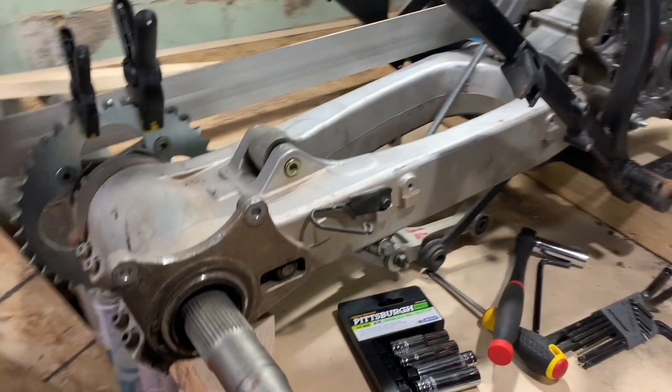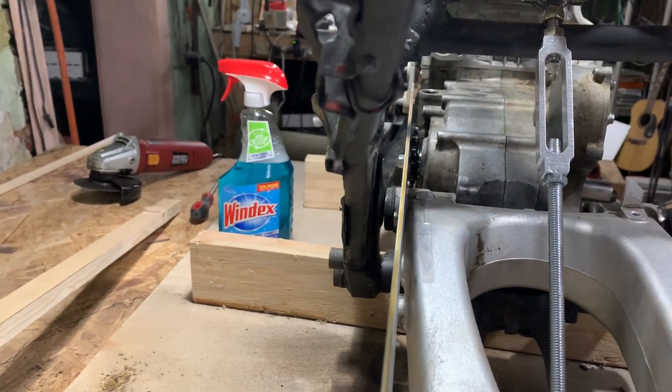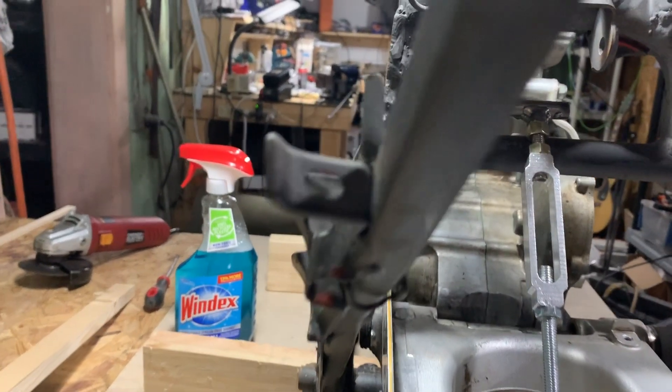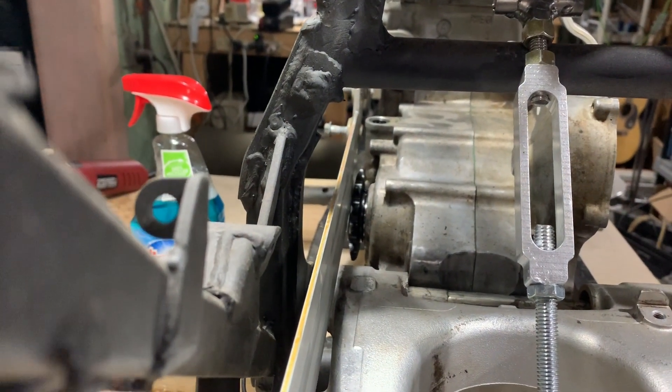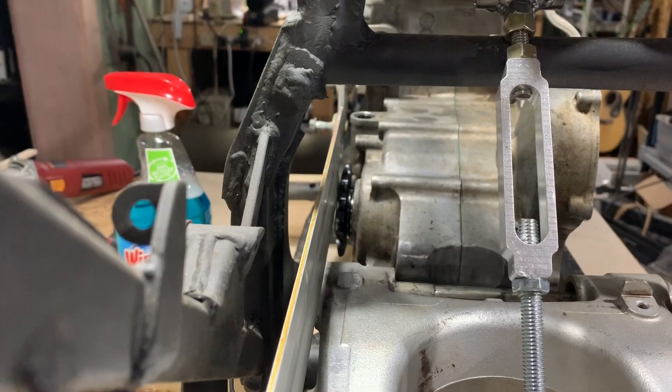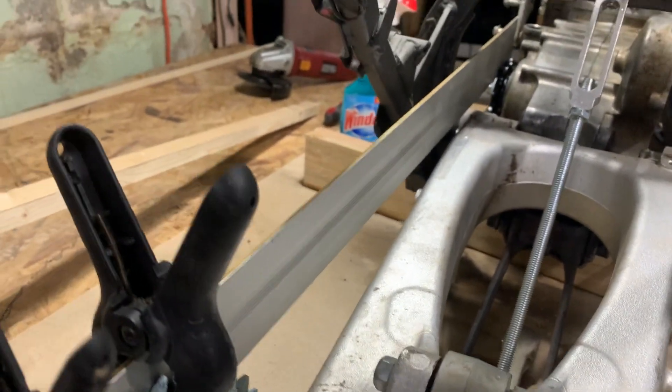Just to kind of line it up, I used the straight edge on the end of the rear sprocket, taped it and set it to line up at the front sprocket. I'm going to use something more rigid — a piece of steel, maybe with an angle on it, so it won't bend and I know it's straight.